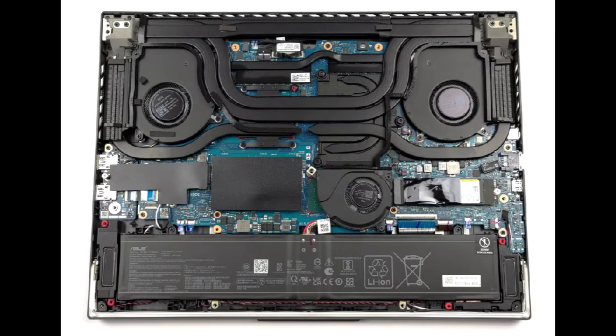After you do, this is what you're looking at for the inside of your computer. Now as a general computer repair side note, whenever I'm working on a computer in my shop, it's sitting on an anti-static mat. Either that or an anti-static bracelet are great ideas to avoid damaging anything in your computer when you're working on it.